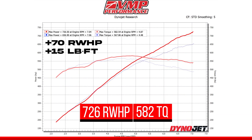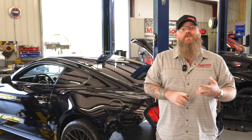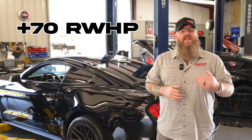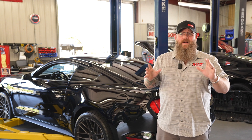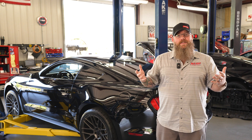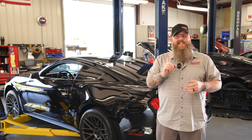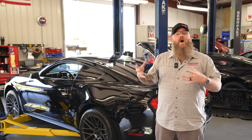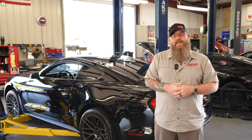So there you have it. The car made a very healthy 656 rear wheel horsepower with the Roush kit and the VMP power package for Roush blowers. Swapping to the Gen 3R, the car picked up 70 wheel horsepower and made 726 rear wheel horsepower — that is a head unit swap alone, again with all the same parts on the car, even down to the same calibration. So if you're interested in something like this, be sure to give us a call at the shop or visit vmpperformance.com. Definitely stay tuned because we're not done — we're going to do a little bit more to this car and show you what that added headroom looks like. Be sure to like, share, and subscribe, and we'll see you in the next video.